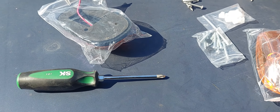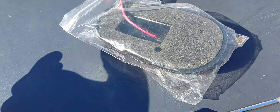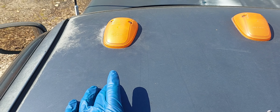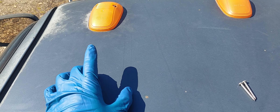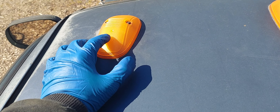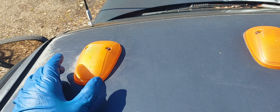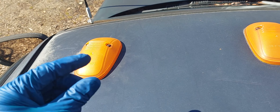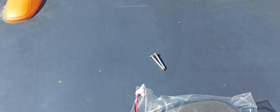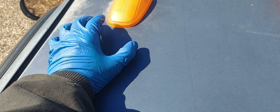This was a shorter experiment than I had thought. They fit and they don't fit. You can see on here these have a pigtail, and underneath that the bulb socket clips into this housing - a typical '60s/'70s/'80s 194/168 socket where it's that two-wire plastic with the four points and it just goes in a quarter turn and locks. With the extra pigtail, there's not enough room when you go to push everything down. I did get the new light to physically fit - it is the same size, the holes are in the right location.